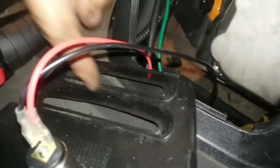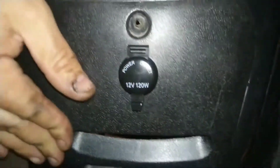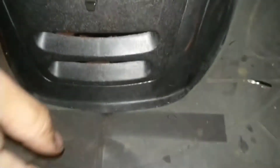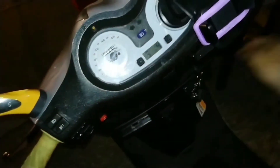You can see all that oil, all that spray down there — it's just been blowing all up in here. That should resolve the issue. I went ahead and cleaned this off real good with some degreaser, so now all I have to do is put this back on, put the one screw in, and we're pretty much done. Literally just slide this back into place, give it a smack until it lines up, put the screw in — valve cover job done.